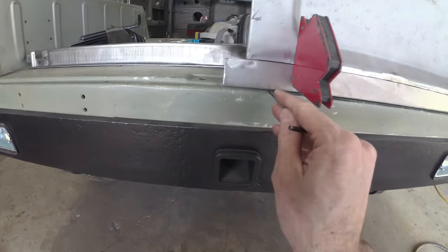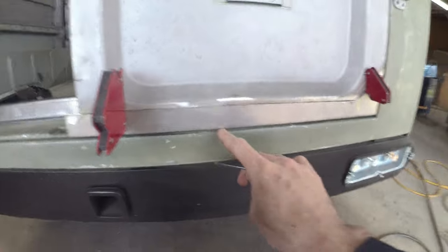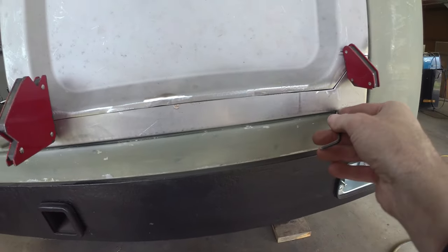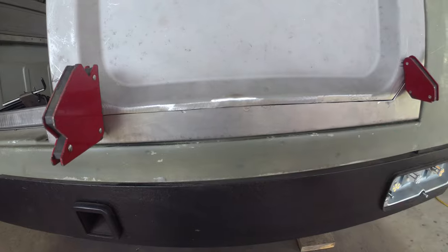But anyway, in the meantime, grab the old panel gap measuring tool, AKA a 4mm Allen key. You can just tuck it under there. It gives you a good idea of the gap I've got. It is just a little bit snugger in the middle, just by a whiff. But as you get back down here again, that 4mm fits. So I'll see if I can bring this up just a smidge. We can take a little bit off of there.